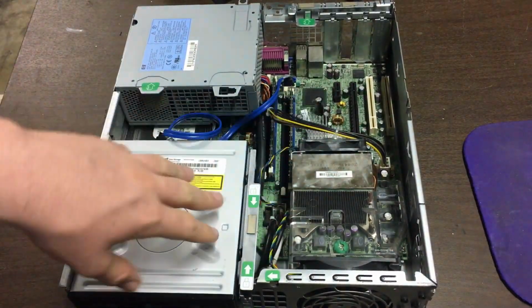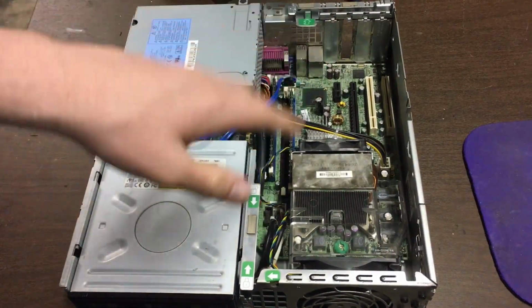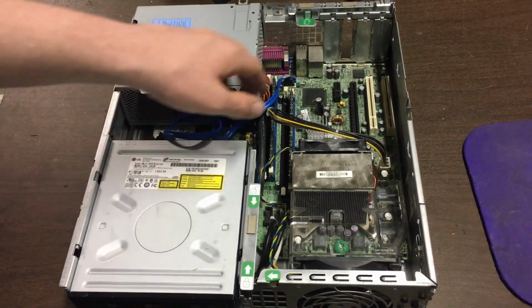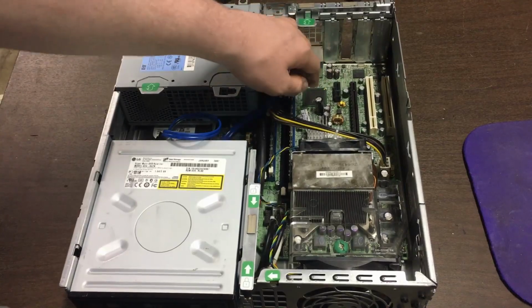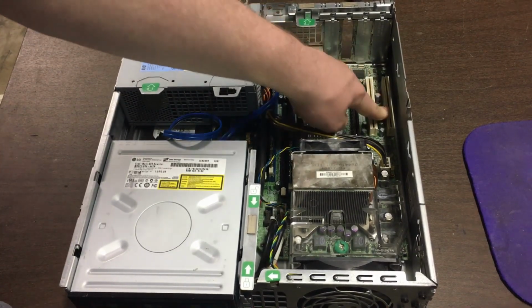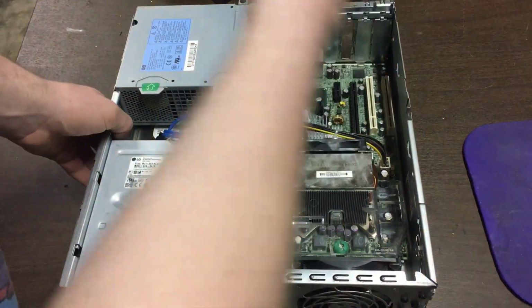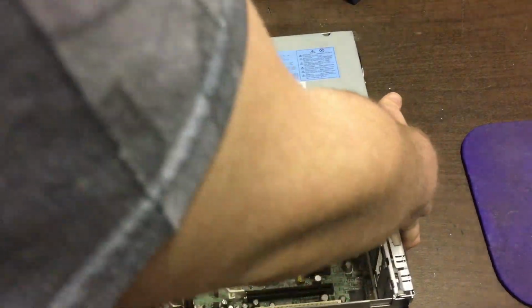This machine is actually pretty quiet. Unless you really stress it out and then both fans ramp up and it's a little noisy, but not unbearable. And for I/O expansion, I actually have a PCI Express 1X slot, a 16X slot, and 2 PCI slots. So we do have potential to upgrade it, which is kind of the whole point of this video, and you probably saw it in the title.